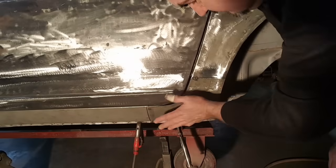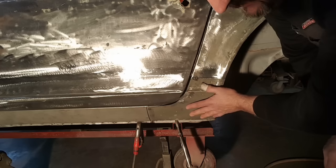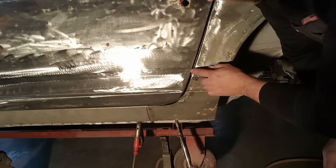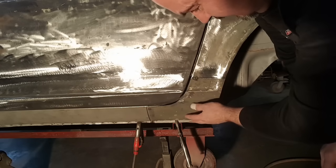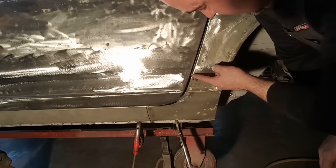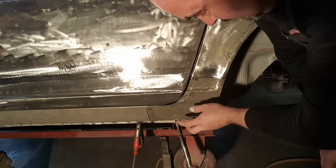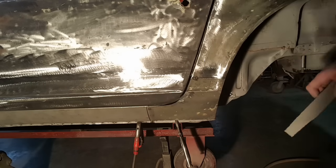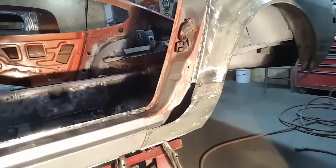I'm going to start off by showing you this piece that I got. This is an original quarter panel section — well, it was a piece replaced on the car. Another quarter panel wasn't properly installed and it was a major issue with gaps. I had to readjust the gaps and widen them up. These corners were nowhere near where they should be, and this body line here was not even lined up — it was somewhere up around here. So I had to cut it off and extend the bottom of the quarter panel down so I could get this piece to fit properly, and I had to trim off all this here — the entire outer skin section.